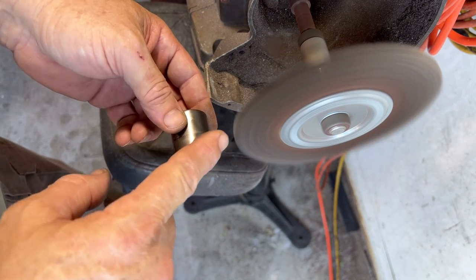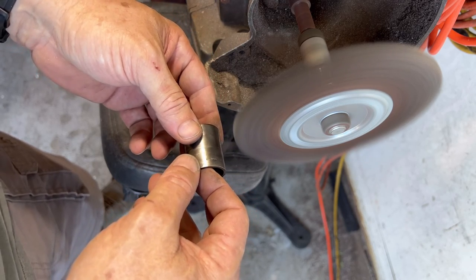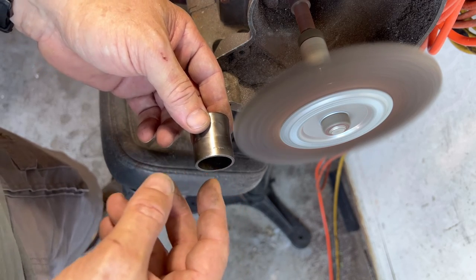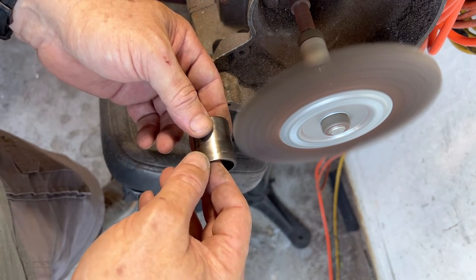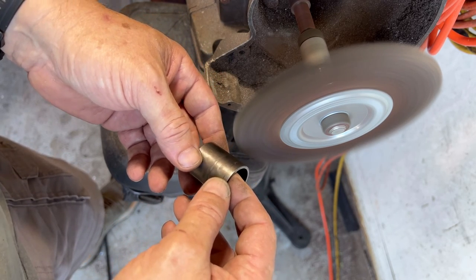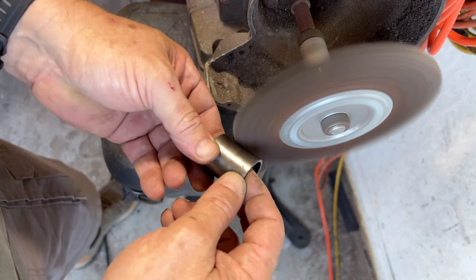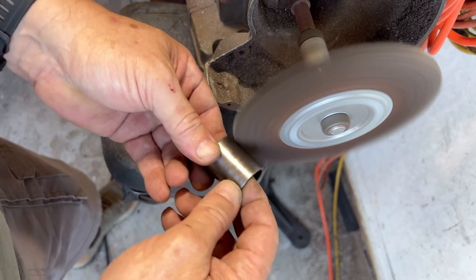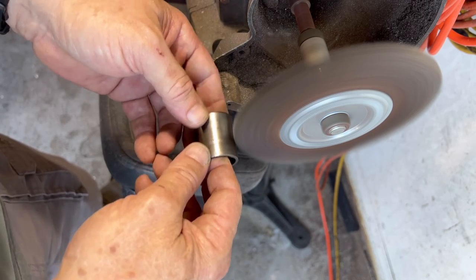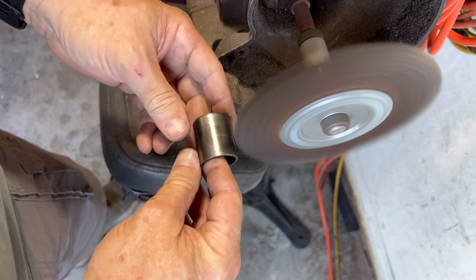Okay, there's multiple things when you're working with a wire wheel. Straight on cuts deeper, stronger, it's more force, if you will, because the wires only deflect in one direction. Off to the side, it deflects in two directions, so it's actually softer if you go along the side. It doesn't cut as aggressively. Just spot on directly, it's more aggressive.